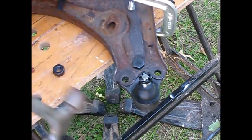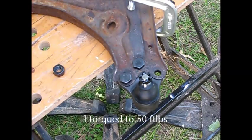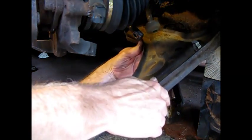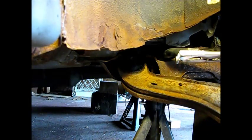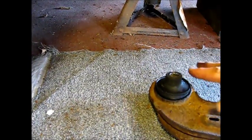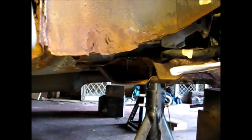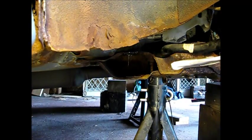It's a close fit, to say the least. We'll get them all in there and torque them down. So now we're going to remount this lower control arm. I've got it in position. Our problem with seating this is over on this side. What we've done now is canted this isolator forward, got it all the way down, even below the surface, then pulled it back. Also greased it up there in an attempt to get this close-fitting part to seat.